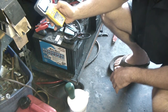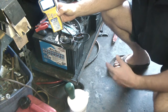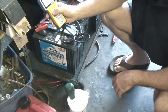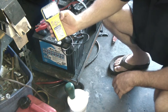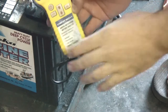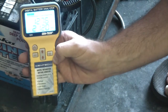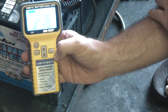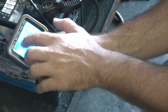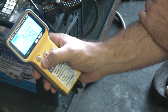Okay, test on — it's testing. I've had this battery disconnected from my bank for about an hour, so it probably still has a surface charge. It says 12.67 volts and the internal resistance is 21.20. Let me zoom in so you can see that on the video. Right now it's showing the battery life — basically what this thing actually is — and it says it's about 30% capacity on this battery. This was actually the battery I had the biggest problem with.